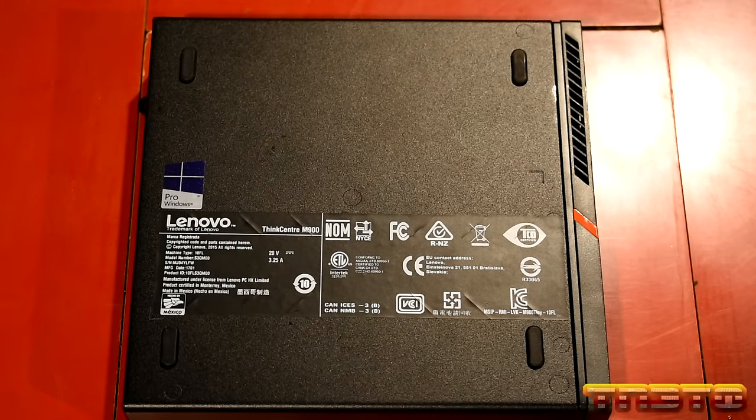But yeah, I was able to get the speaker out, hopefully without doing too much damage, right? It's just a little 8-ohm 1.5 watt speaker, according to the specifications. Very tiny. So we'll go ahead and clear up this thermal compound off both the CPU and the heatsink, and I'll get the tools for that set up.